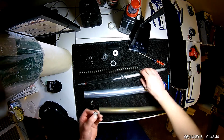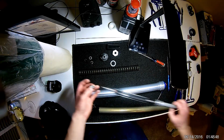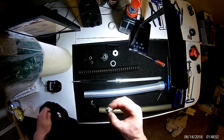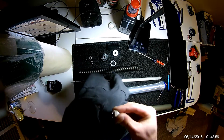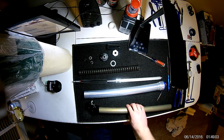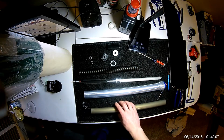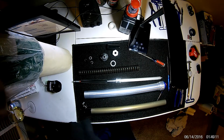If you can't get it out, take your cartridge and just stick it in there, and you can use your cartridge kind of as a tool and push this nut out. And go ahead and wipe this off. Reason being, you want to inspect this bottom O-ring. So this is the nut that holds your cartridge to the bottom of your fork tube so that it doesn't come flying out and rebound and you lose your front wheel. That's the last thing you want to happen.